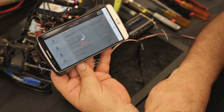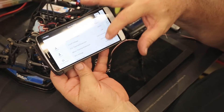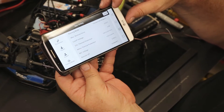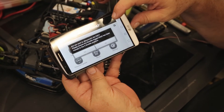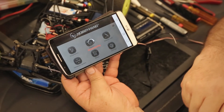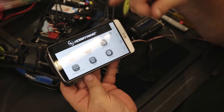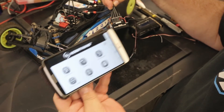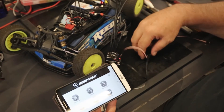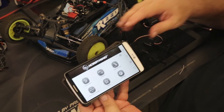You simply hit 'save.' It says please ensure everything's operational — I say yes, and it's now saving. Save successful. Now we have our three volts and 125 degrees for motor protection. I exit back, hit yes to disconnect, and we're back out. So it's very important on this first time through that we upgrade to the very latest firmware on the speed control to make sure everything's compatible between the phone software, the new Wi-Fi device, and the firmware on your speed control. That's all we've got — it seems to be working just fine, have fun.